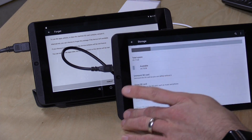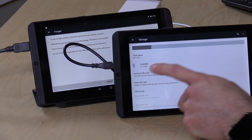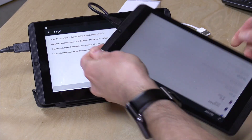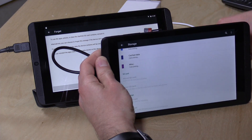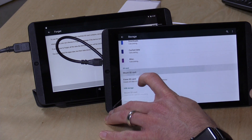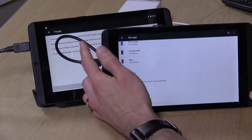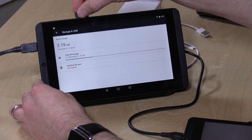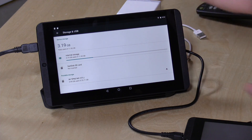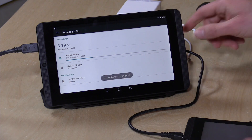What happens when we plug it into a different tablet? I'm going to move in another NVIDIA tablet and pop out the card that's in there — this one is on the prior version of Android Lollipop. I'm going to put in the card we formatted for internal use on the other tablet. What should happen is nothing — we should not even be able to mount this card. I've inserted the card and I have the option to mount it, but as I tap on it I can't do anything with it because it simply can't recognize it; this card has been encrypted only for use on the other tablet. However, I can insert a different SD card into this tablet as portable storage and use it to move files back and forth.